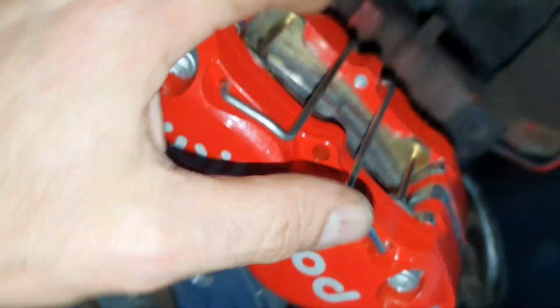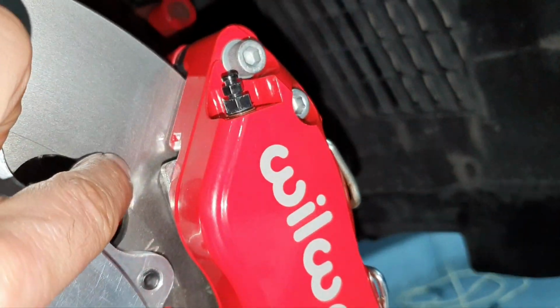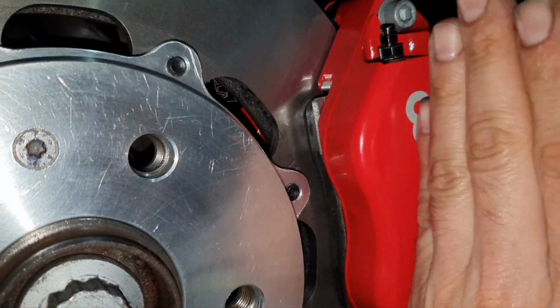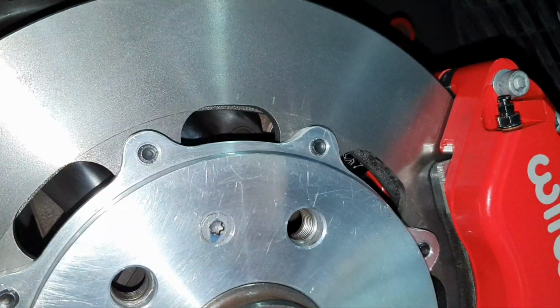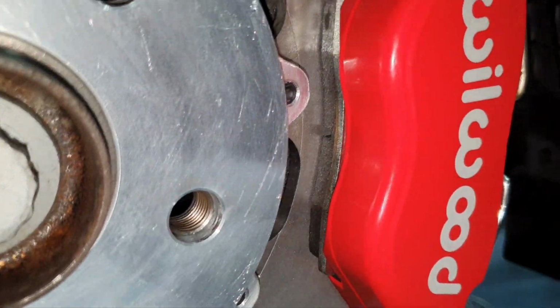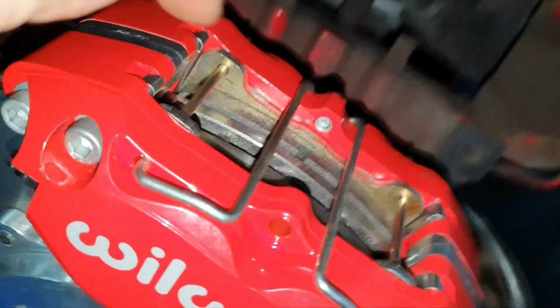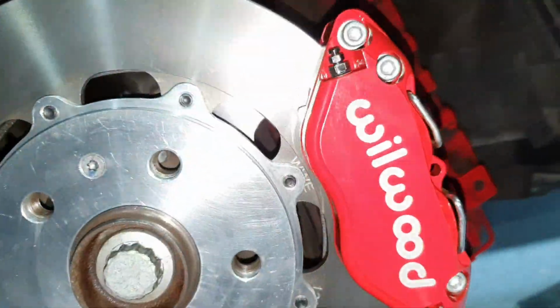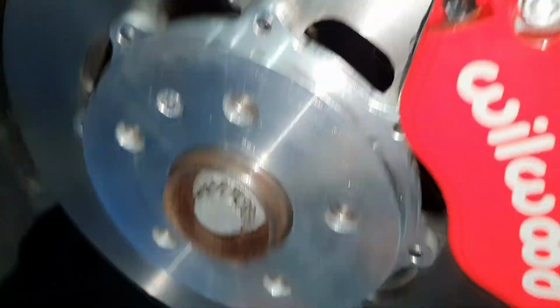The brake pad is a little bit more out than the brake rotor, and it's stepping till here. So that means if you move the brake caliper more inside, you can skim a bit the brake rotor, and you're gonna remove more weight. Or at least you're gonna step equal to the brake pad, because otherwise you're gonna make a lip here later on. At this point, and at this point, you're gonna make a lip and you're gonna start making sound. You're gonna clean also this. You're gonna always clean the top.